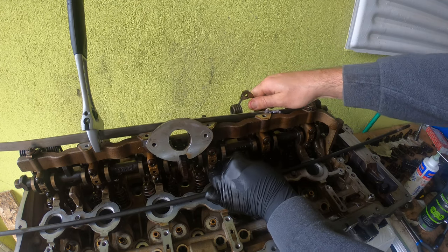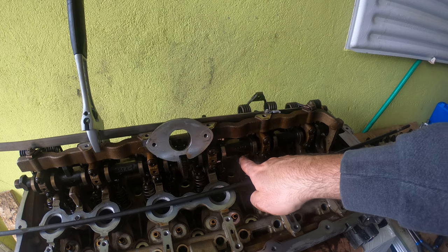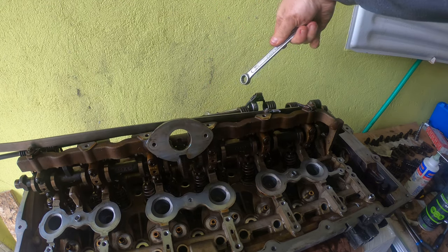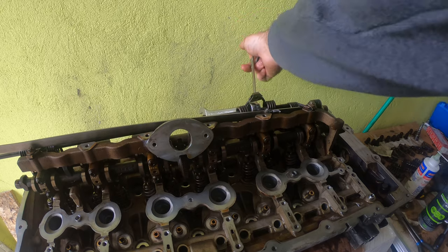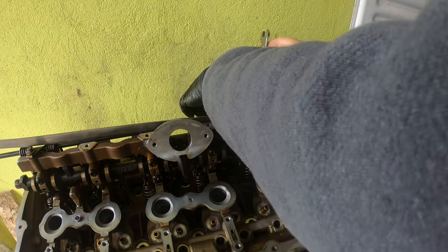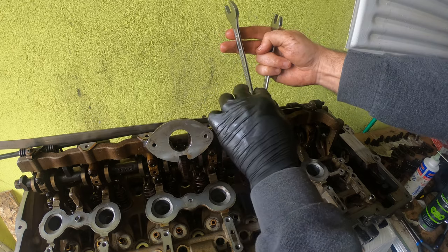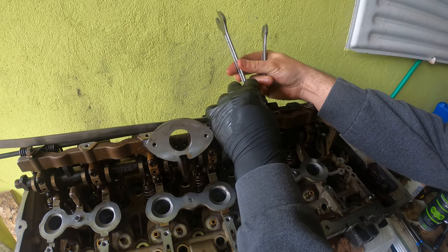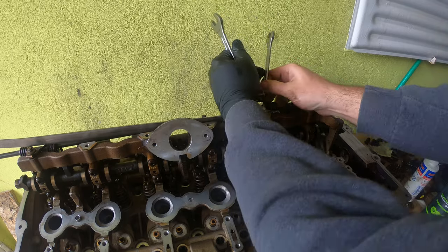So we're going to just look underneath, navigate to the tabs, make sure the spring ends are in the little tab there. We're going to then put our spanners and rod through. Come on. We don't got all day. What's going on? All right. And then we're going to just prep our bolt. When you actually put a little bit of pressure on there, it kind of cinches down in there and it doesn't move. Now that we have pressure on that, we're going to just push this down a little bit. Get those into their tabs, which it doesn't want to do. Super.